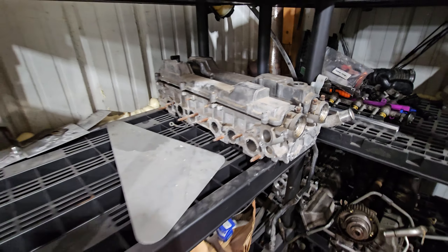I'll just tap the threads since there's no pressure there, so it should be good to go to run a cam sensor. This is the OEM one, and it has to be set pretty precisely. With a Haltech cherry sensor the entire sensor is threaded, so I can set it to whatever position I want. The only issue is there are some pull-up resistors and voltage requirements I'm not entirely certain about. I'm hoping to find one that's just a two-wire sensor — cam input and a sensor ground — and I'm going to do some research to see what I can find.